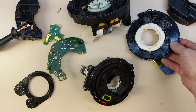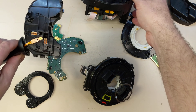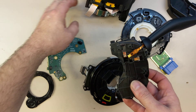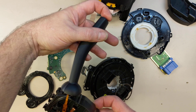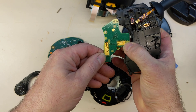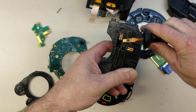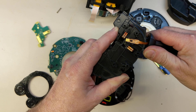This whole assembly is pretty complicated. You've got two stalk modules. I didn't take this one out, but it's pretty much identical to this one. Inside is a little circuit board that's connected to the main board by a ribbon. Ribbons are here. And there's also a little ribbon that runs off that secondary board up to the button at the end of the stalk. If you look on the back of this board, there are gold-plated contact areas here that these little sliders slide over. So that's me doing the high beams, and then this one would be the turn signal.